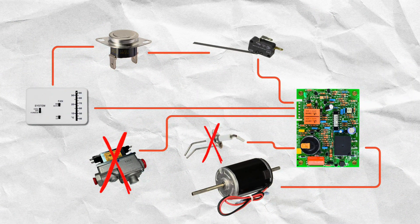So if everything in the last five steps happened according to plan, then the furnace should be running. It's going to run continuously until the thermostat reads that the internal temperature of the RV is equal to the temperature that you set. Then step six, the thermostat is going to send the signal to the circuit board telling it to turn the furnace off. The circuit board still wants to be safe — once it gets the signal from the thermostat to shut off, it's going to stop the gas and stop the spark so there's no more fire, but it's still going to run the fan for another 45 to 90 seconds to purge the burn chamber again of any excess propane so we don't have any flammable gas just hanging out inside of your furnace. This is again why the furnace is going to blow cold air after it shuts off — you just got your RV up to temperature, but it is a really good safety mechanism because we don't want extra propane just hanging out in your RV.